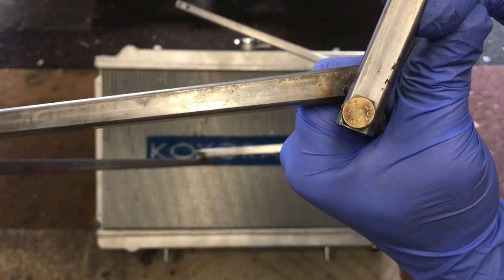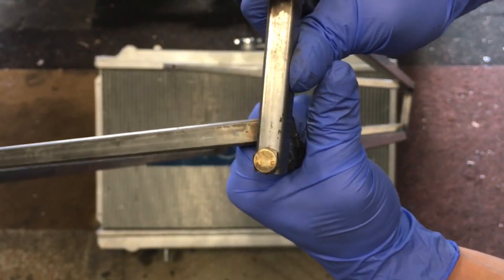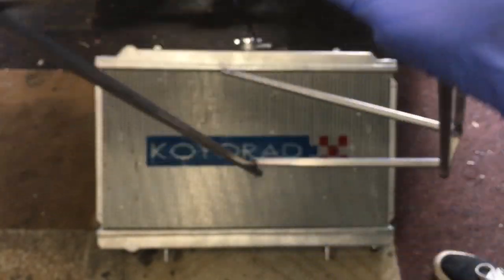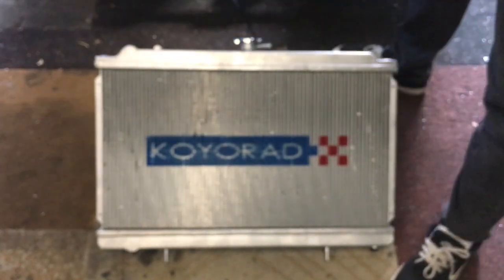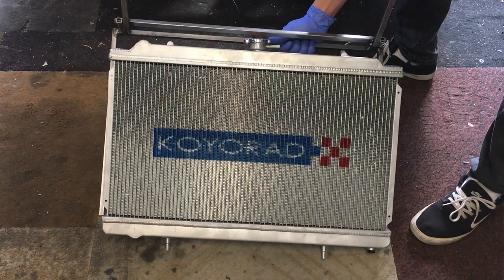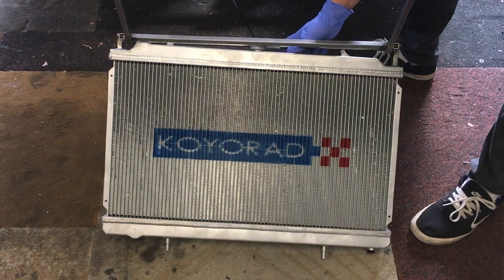Now that that's done, I welded two quarter 20 nuts to the open end of the bottom of the intercooler bracket to make it like a hinge. This will allow the V-mount bracket to have a wide range of positioning as well as being able to be disassembled if the engine ever needed to be removed or serviced.